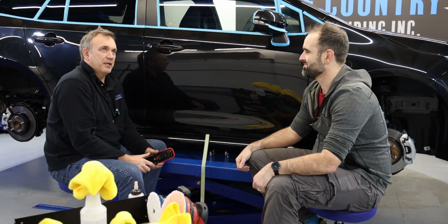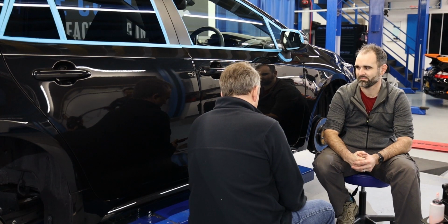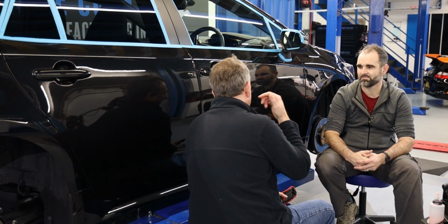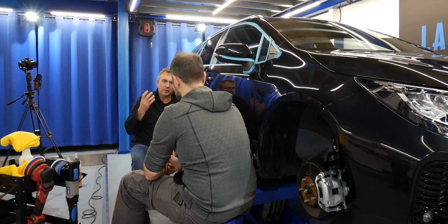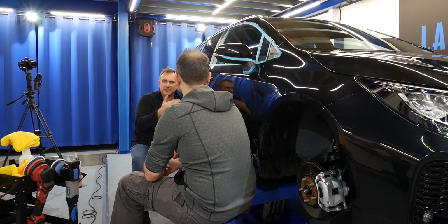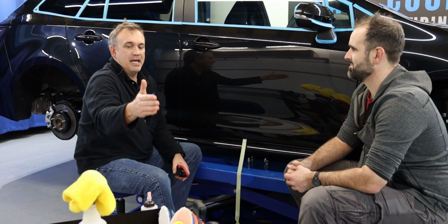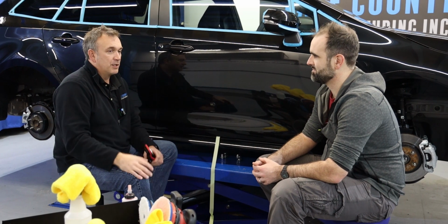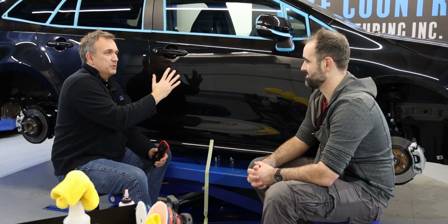I think, and this is just an analogy or possibly a prediction, through a little bit of experience of teaching, if you always select the least aggressive pad, orbit size, machine and compound, you're pushing it to its limit to try and achieve results. Yes, it's like we said about racing a car that's got very little power. Once you've got a heavier hitting, so the higher orbit machines and then microfiber or microwool or wool pads, which everyone's always scared of, as I said, come off the throttle. Just be gentle, and then you've got the ability.